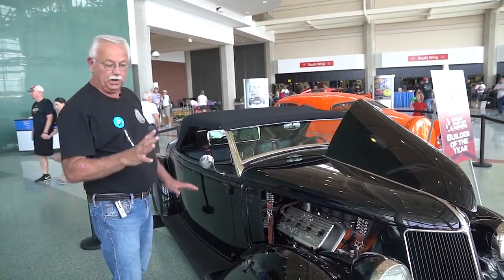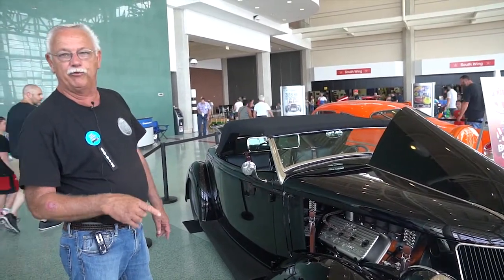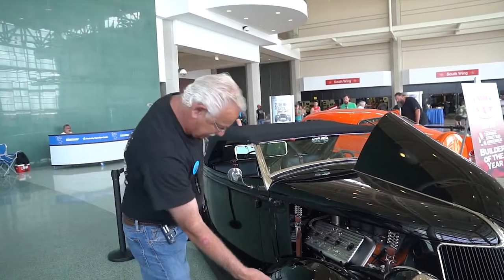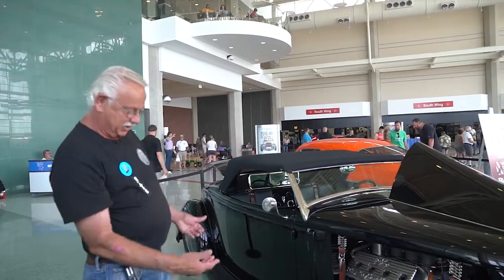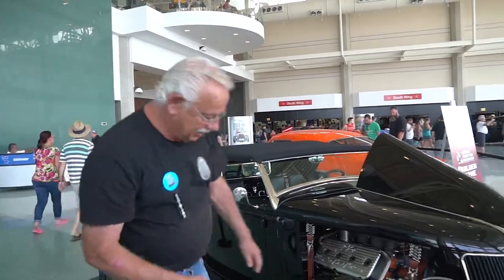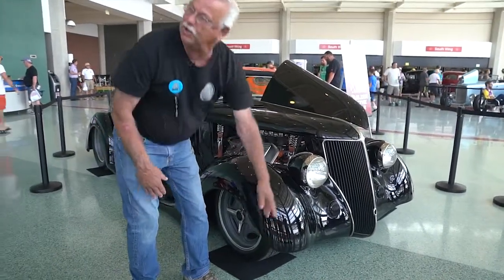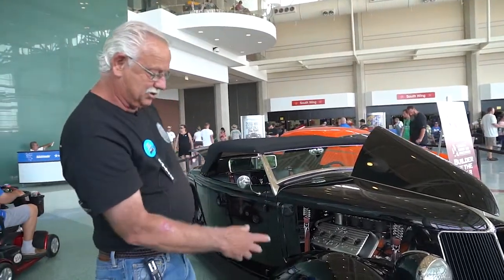We had a really good set of front fenders, but with all our modifications we had 14 feet of weld in each front fender — they're sliced all the way around. The openings are actually raised on this car. We cut the whole bottom up: the running boards and both fenders. We raised them up an inch to try to get ground clearance. And remember I said we raised that grille an inch and a half — you can't just bend it at one point because it won't look right. You have to do that very gradually in your movement of the steel so it still looks stock.